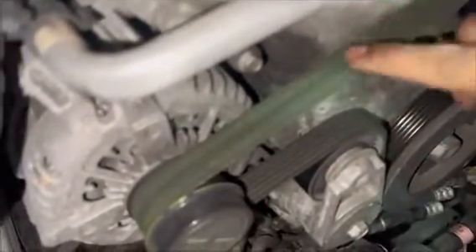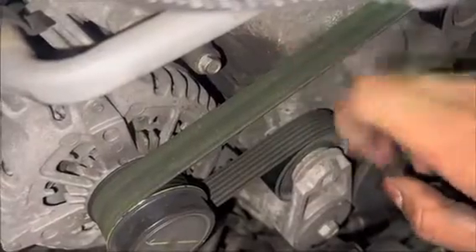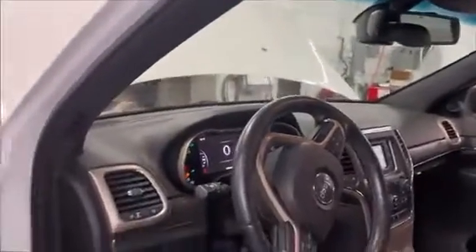Air filter felt in good shape. Cabin filter is a little dusty, but nowhere near a concern — this is basically new. As far as your screeching complaint, I was able to confirm it to the drive belt. As you can see, there's a yellow crayon on here. The wax in the crayon helps silence the belt, so that narrows it down to this belt needing to be replaced soon. Your wipers do leave a bit of a streak behind, but I think that's more of a problem with the windshield being dirty than your wipers being worn. We'll go ahead and splash some glass cleaner on there before the car leaves.